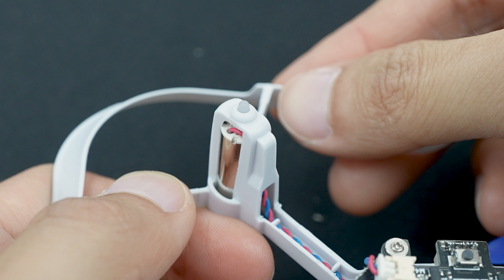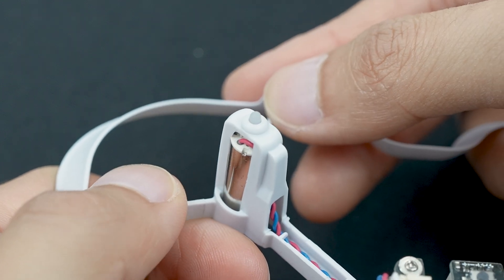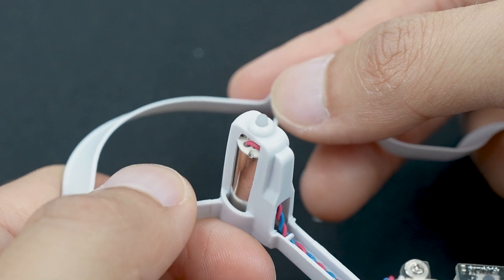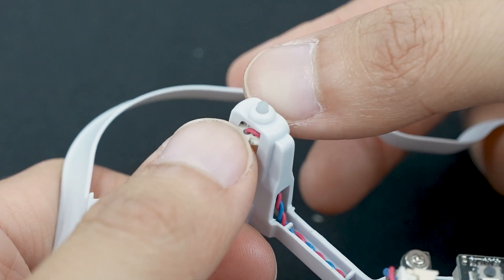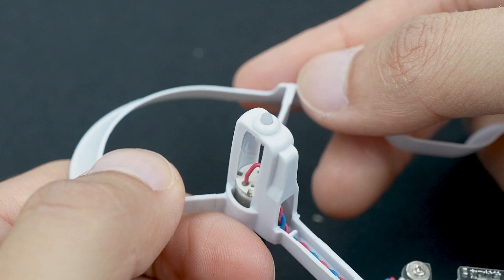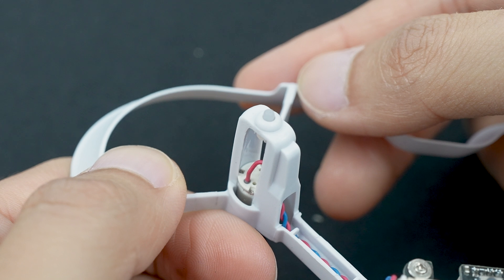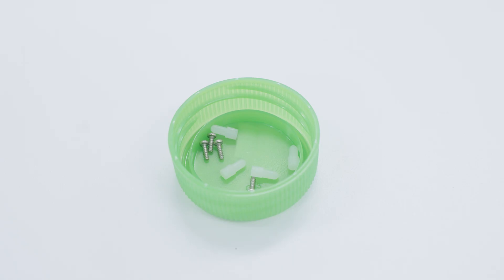Before removing the motor, be aware that there is a rubber bumper at the bottom of the motor. When you go to push the motor out of the housing, this bumper may come loose. Now you can push the damaged motor out of the housing. You can use a two-thumb method by holding the arms of the motor housing with your fingers, then pushing upward with both thumbs on the bottom of the motor, like this. You can leave the motor just partially pushed out for now. Make sure you place the bumper in a safe place with your bolts since they are also easy to misplace.